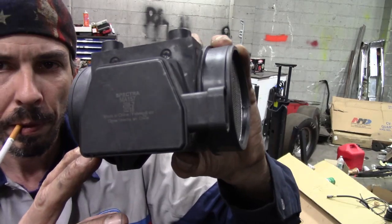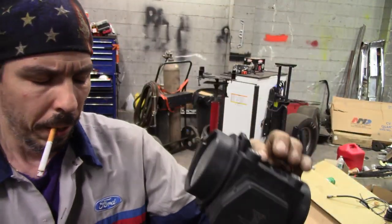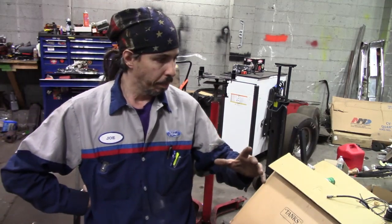This is the mass air meter off this vehicle. The original mass air meter on this car was a Bosch. I wasn't aware of this until recently, but speaking to a gentleman from Automotive Training Solutions - he was telling me that these Bosch units were actually used on BMWs from back in the day. This is the system that has the mass airflow burn-off relay - it activates when you shut the car off to burn off any debris that may be caught on the filament, the hot wire. I did not know it was a BMW or European design until recently. Not that it makes a difference either way.